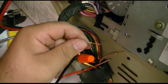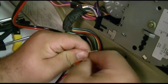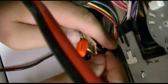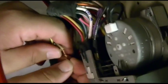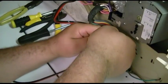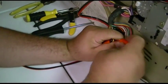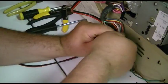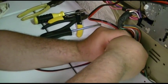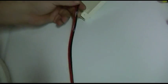I'll use the red on this side — that just happens to be the color wires I had, it really doesn't make a difference. We'll start by putting the wire nut down, putting these together, and the wiring here — there's just barely enough because this was never meant to be. This wire will go in here about like that and then we'll twist those together, squish that, and put the wire nut on. Obviously I'm going to electrical tape the heck out of this like I did the lid switch kill.